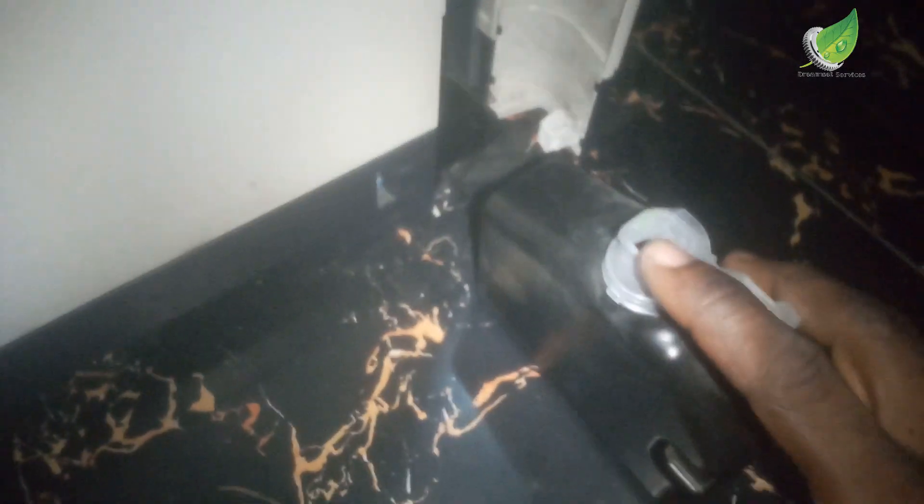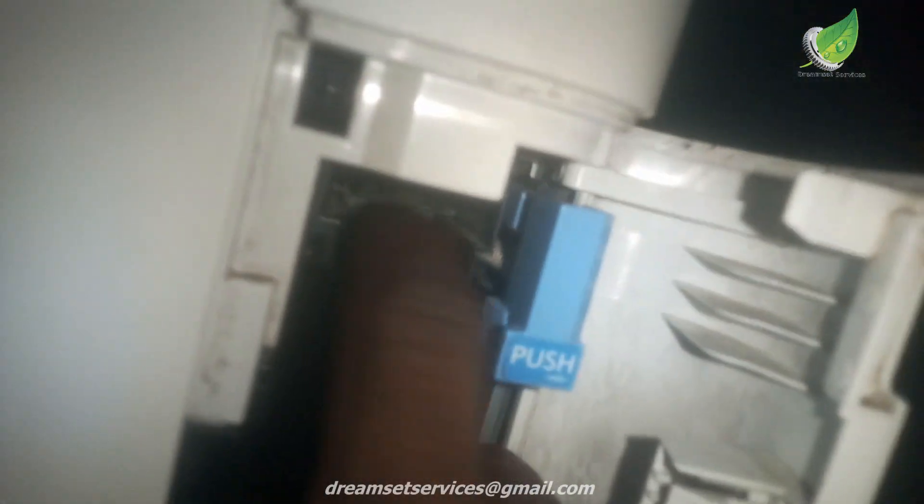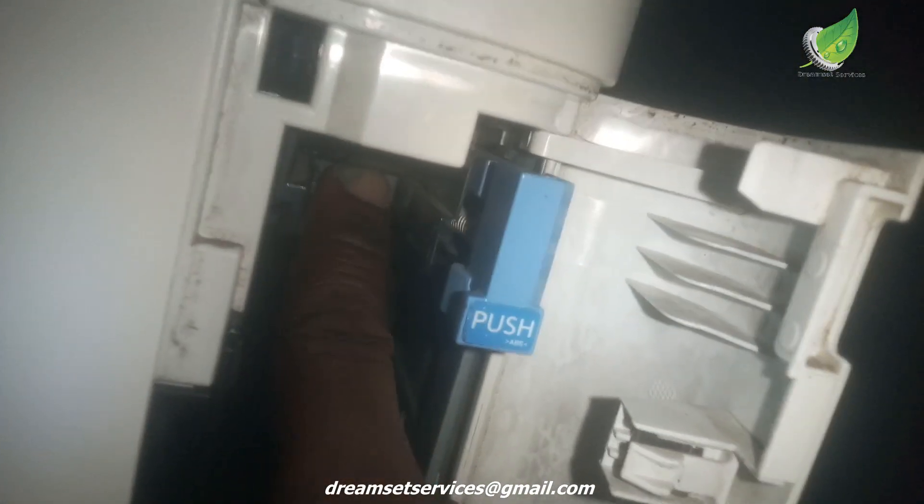You can see this is where the waste tank is located. I'm going to open it and see what the problem is inside. This is the waste toner — I'm going to remove it carefully. It's complaining that the waste toner is full or placed improperly, but from what we can see here, the waste toner is not full. This is the sensor for the waste toner.